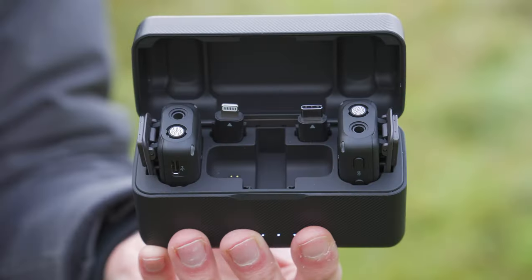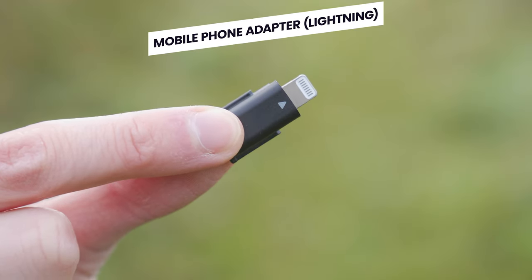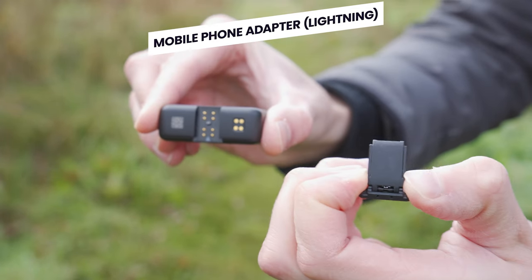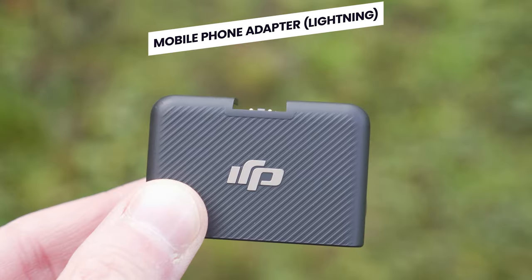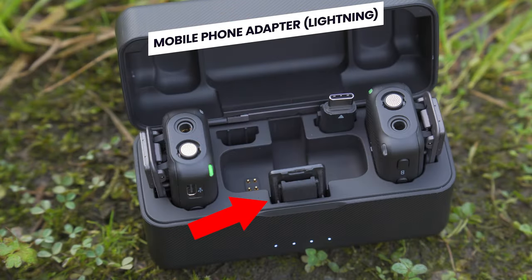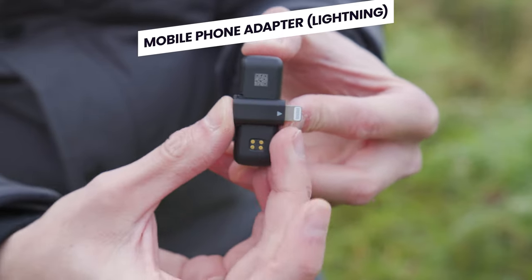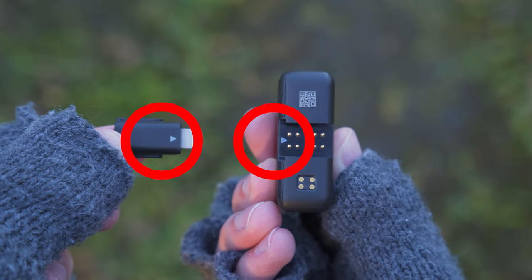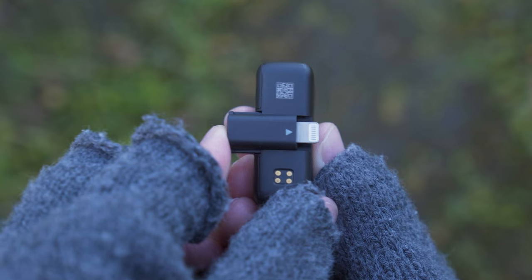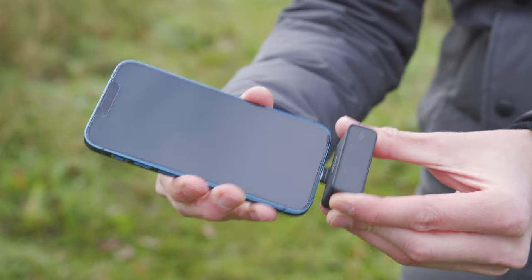The first adapter has a lightning connection for an Apple iPhone. To swap the adapters, you simply want to pull the currently fitted adapter downwards from the bottom of the receiver until it is removed, and this can be stored in the slot in the carrying case when not in use. Then simply slide the lightning phone adapter into that same groove, making sure that the arrow on the adapter and the arrow on the groove are facing the same way. Once attached, you can then connect your receiver to your mobile device.